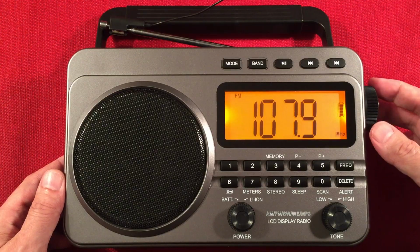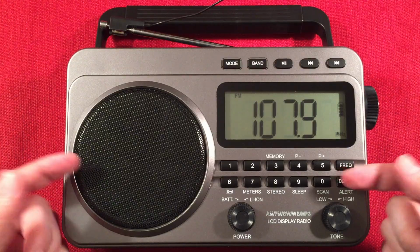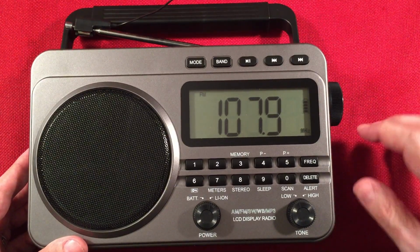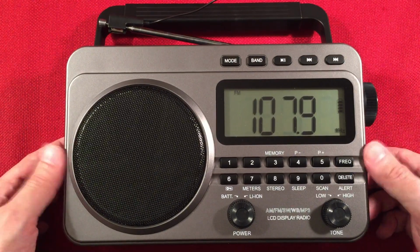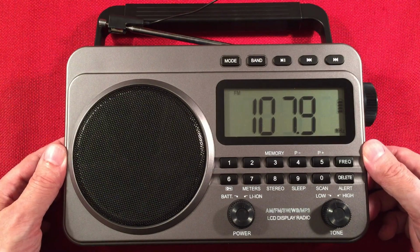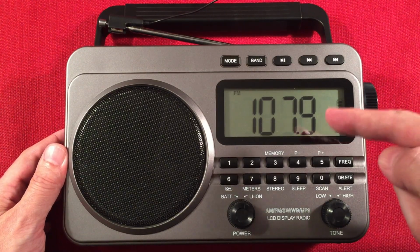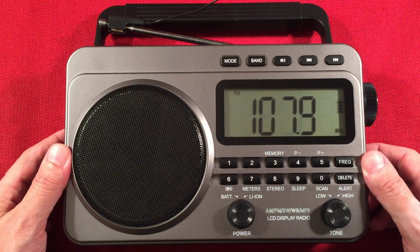So there you go. That's the FM band. I had to go through the whole thing because it's fantastic sounding. I forgot to mention the FM reception report. It got a 3.5 star rating. So good to very good. If anybody knows my 5-tier rating: fair, okay, good, very good, excellent. Most are okay to good radios. 48 stations found on a typical analog radio. This is digital, DSP controlled, and I found it has 73 stations, which puts it solidly in a good to very good category. So 3.5 star rating, and it did good on selectivity as well. As you saw, I was getting stations faint next to strong stations, which is fantastic with this radio. You will love the FM performance.